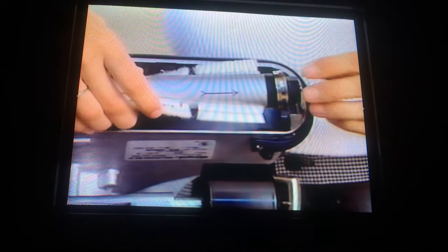The brush roll of the Royal is long-lasting with two brush settings to ensure maximum brush life. When the bristles are worn, remove the nozzle plate and brush. On the ends of the brush roll are the numbers 1 and 2. There are extra notches on the roll at position 1. Spin both end caps to read number 2 and replace the brush. The notches will be on the inside of the roll guide. Make sure the arrows on the brush and the nozzle plate are pointing in the same direction.